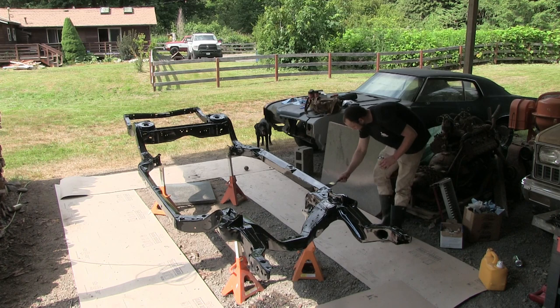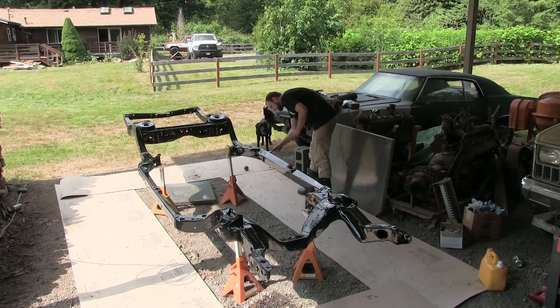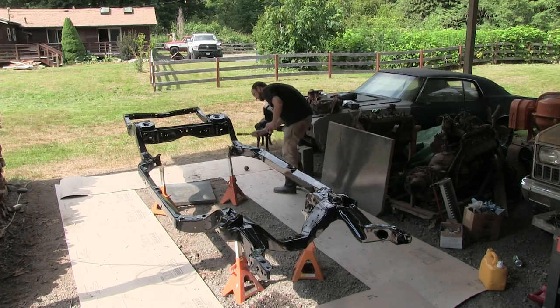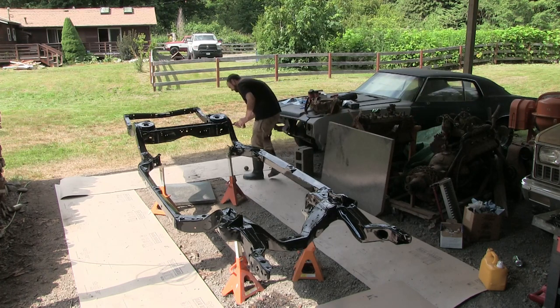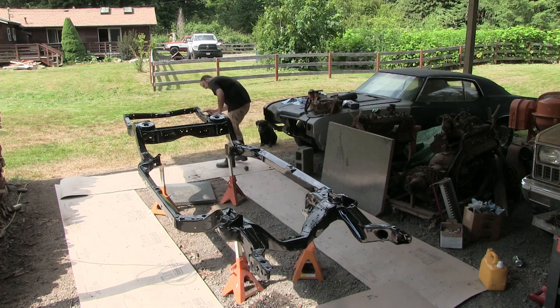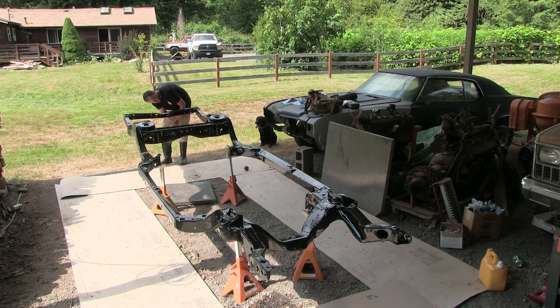And runs under control. And then we'll see how she's doing, and then start with the top coat. This stuff doesn't like UV, so we have to put another layer over the top of it. And if we let it dry too long, we have to sand it, because I guess the UV probably puts an oxidation layer on it or something. The paint won't let the new coat of paint stick if it dries too much. So we'll let her sit for a little bit, and then we'll start spraying. Should have probably grabbed some masks or something.